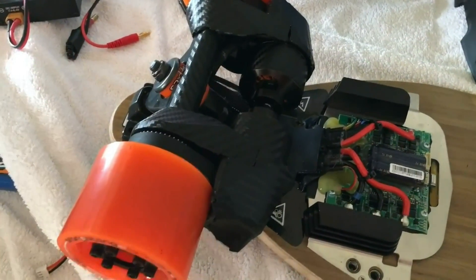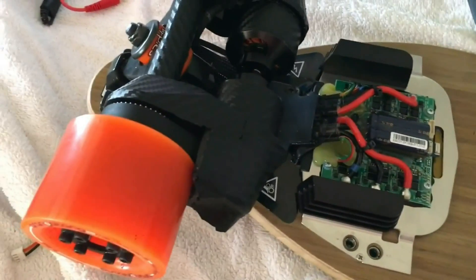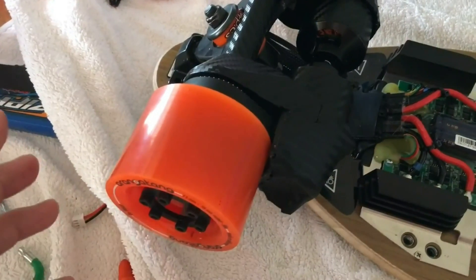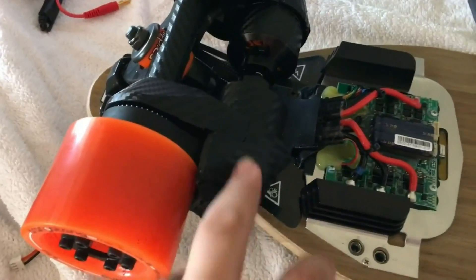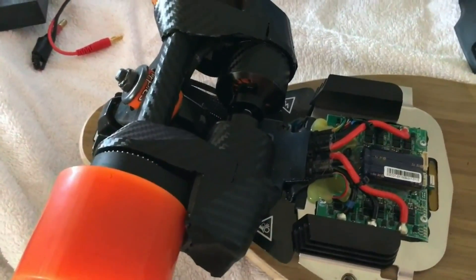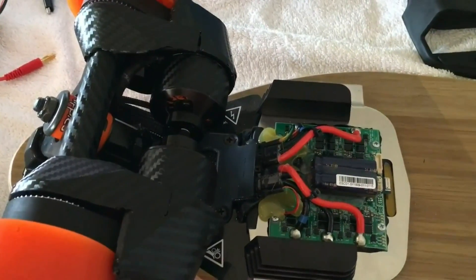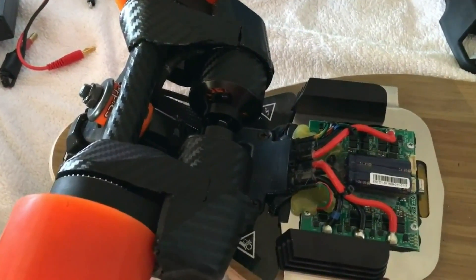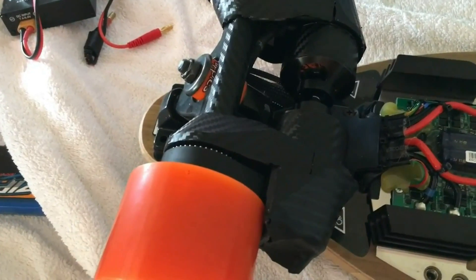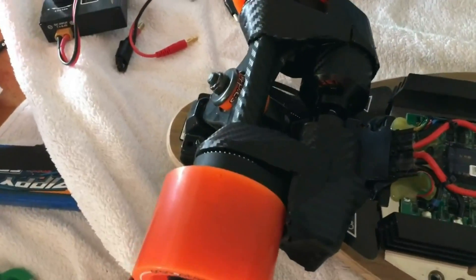For the Dual — not the Dual Plus, but the Dual — I would say that there is some sort of software RPM limiting. For modifications of the boosted board, the only thing I would really recommend is wheel size — you can increase your top speed by 3 to 4 miles per hour. If you did replace the motor with a 270 KV, you'd be increasing it about the same, but there could be RPM limiting still, which would mean you're not actually going to increase your speed at all, only affecting the performance of the board. You could change the gear ratio and reduce it, but I still don't recommend doing this, as the performance of the board is really quite good going up hills.